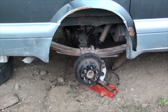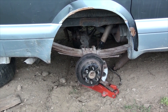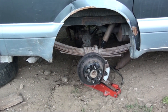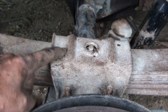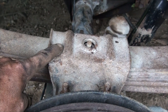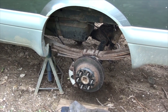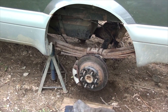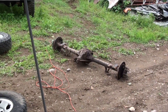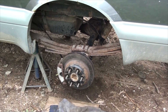I've removed my lift blocks and got the axle slipped up into place. The width of the spring perches does line up with the older style vans — they absolutely will work. One thing to note: not only are the spring perches different, but the clamps are too. So when you grab your donor axle, make sure you grab the emergency brake cables, the clamps, and the U-bolts, because they go with the new style axle. The rain stopped and I'm back outside working. I have the axle mounted and the shocks attached, but we've run into another difference: wheel mounting surface to wheel mounting surface, this axle is approximately 3 inches wider than the old one. It won't stick out that much, but it is something you might want to know when planning your build.